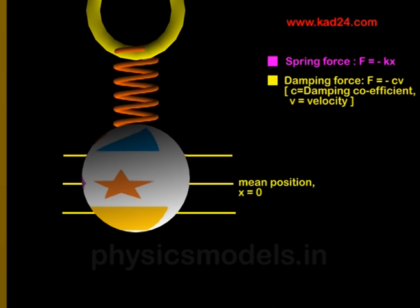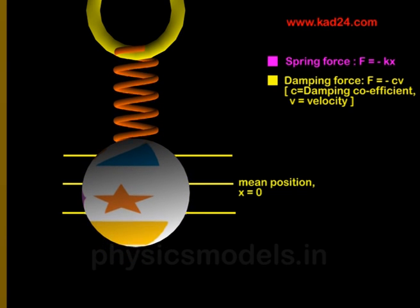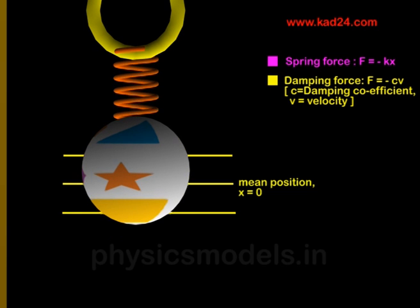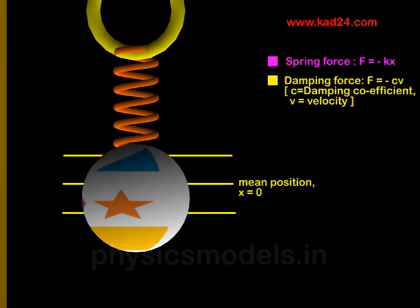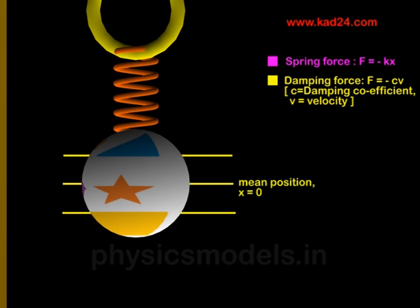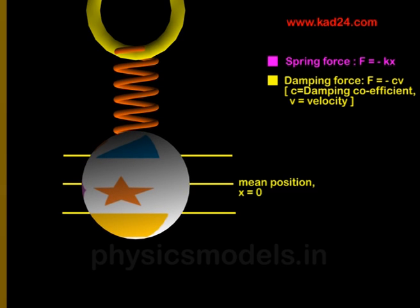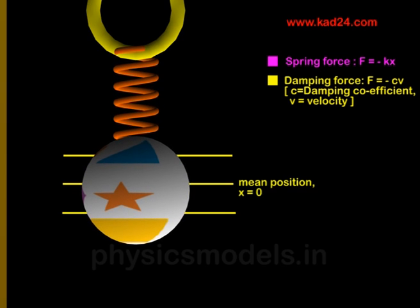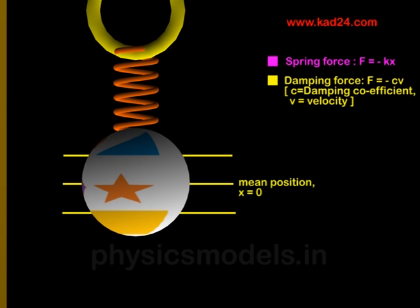This video is about damping of the oscillations. If you do not have a damper, the spring is likely to go on vibrating for a very long time. So if you have a suspension without a damper, those oscillations will continue for a very long time, which is not desirable for occupant comfort. It's important to put a viscous damper, which is normally a hydraulic unit fitted inside the spring.